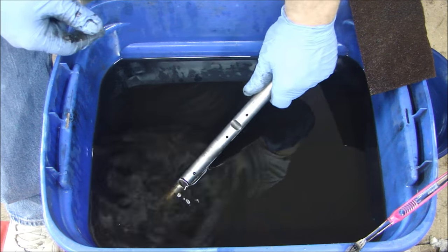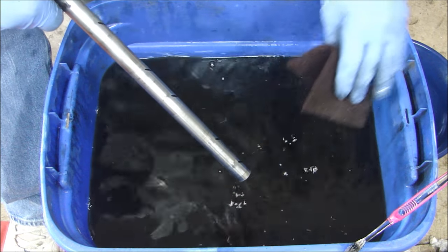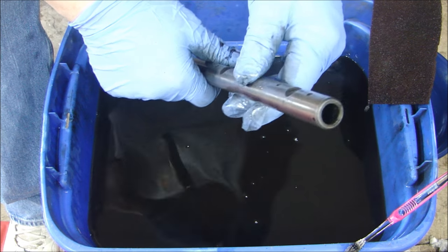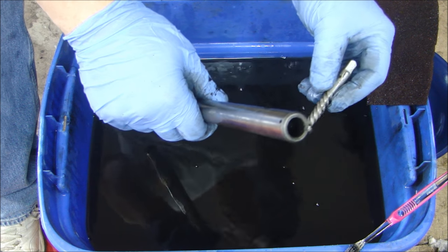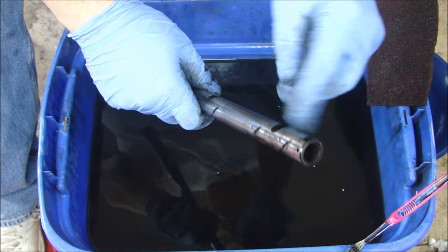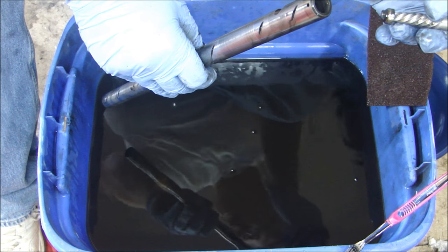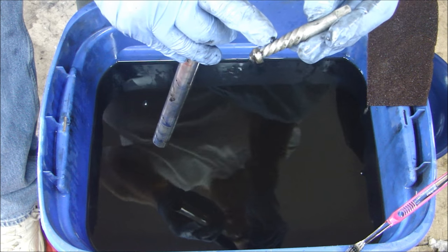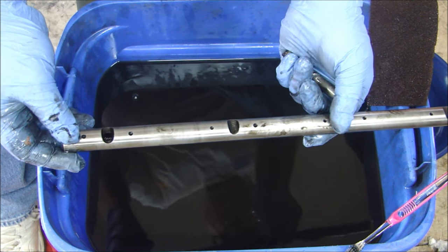I just wanted to add this: if you're redoing your Studebaker engine, which is very similar to the old Ford-type engines, these rocker shafts have plugs in the ends. I want to thank Brad Bez on the Studebaker Drivers Forum — he provided a short list of things that should be done. These plugs on each end are easy to get out. I want to clean inside and make sure all these holes are clean. If you have to put them back in and you didn't measure, they're 475 thousandths deep into the cup — that's how deep you press the new ones in. The easy way to get these plugs out is to drill a hole in the middle with a big easy-out, and you just turn it and it comes right out.